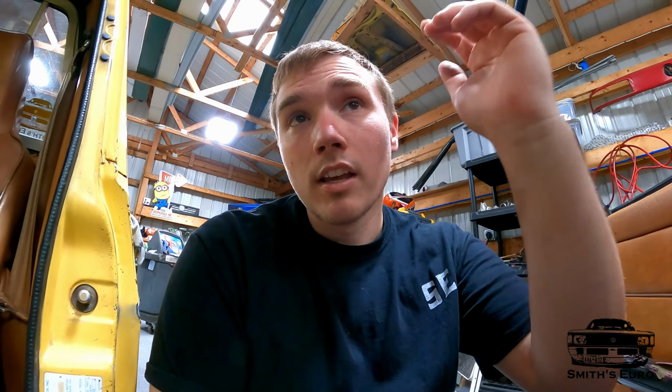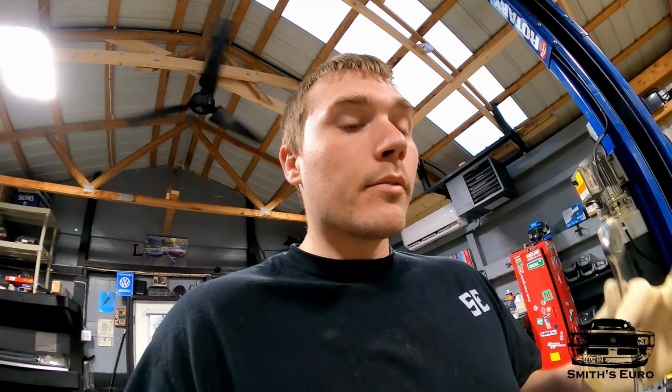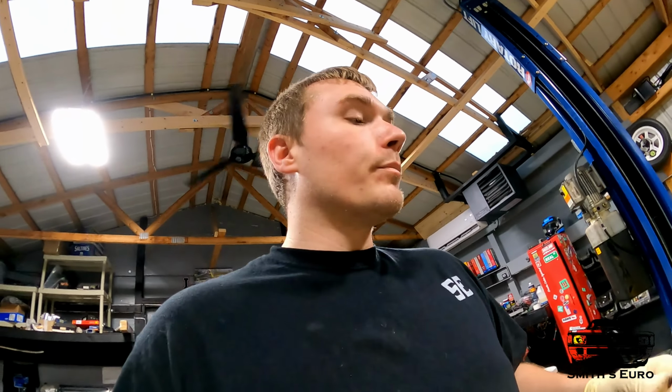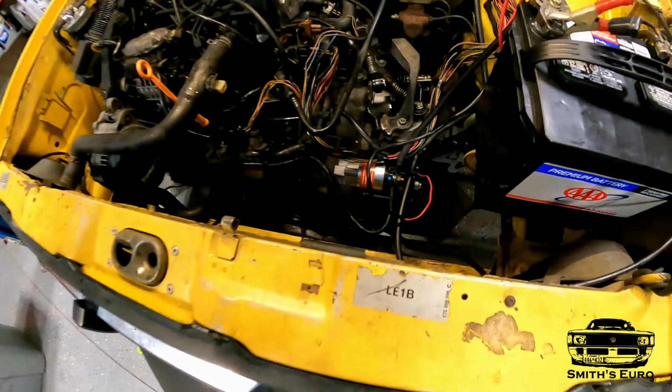You have fuel. All right guys, since I saw you last, a couple things have happened. First is my starter was dead. Maybe it was when I pressure washed it, it rusted it a little more and just didn't work. It just kept wanting to die. Like it sounded like the motor was locked up. So the starter was bad, had another one, put it in. Then that starter got stuck out. It was just an ordeal. So there's a brand new starter there.